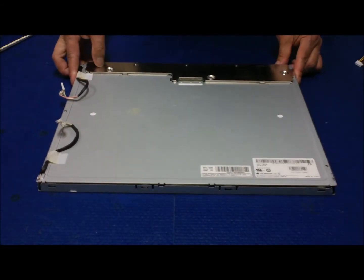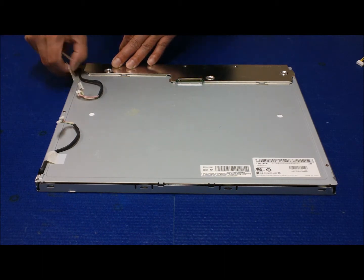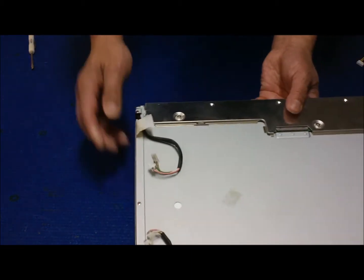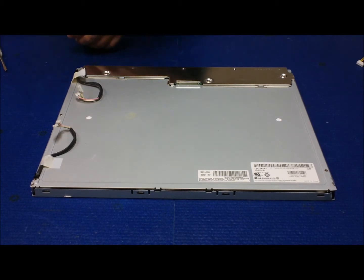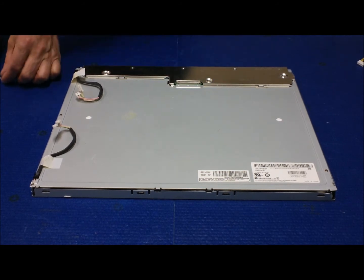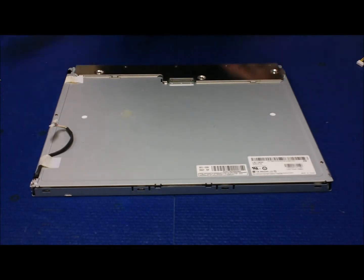The 17 inch screen has a total of four lamps. It's quite easy to replace them. First you have to remove the tip and then the wire holding it. Second, you need to remove the screws — there's a small screw on each side holding the reflectors. Just unscrew the small screw here, set it aside, hold the wire, and just pull it out. So it's quite simple — one is done.